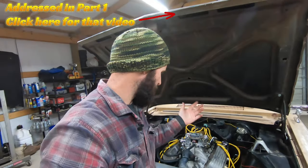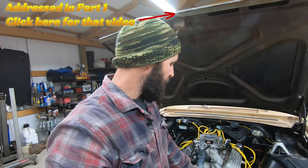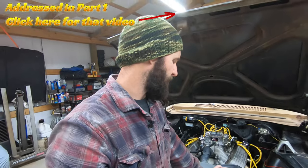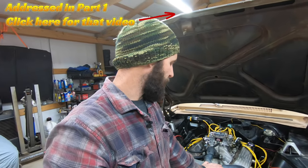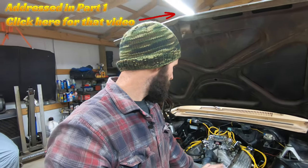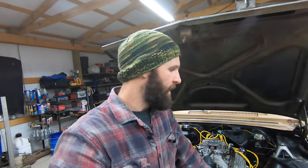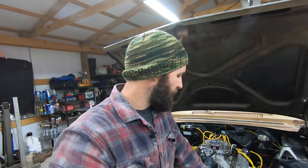Unfortunately, I was looking forward to getting this started so I could see if we fixed the lifter tick that we had, which we should have had fixed right up front when I adjusted all the lifters. I don't think we're gonna have any issues because there were two that were definitely a little bit loose, with a little bit of vertical play in them, which was gonna cause that tick. That's taken care of. They're all adjusted, should be right on the money, but we'll have to wait until the next video for that because, like I said, it's cold. The sealants need a little bit of time to cure up properly. Otherwise, we're just gonna end up with another leak, and we're gonna test my patience.